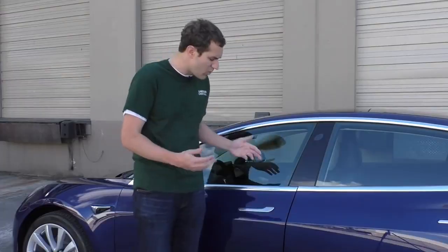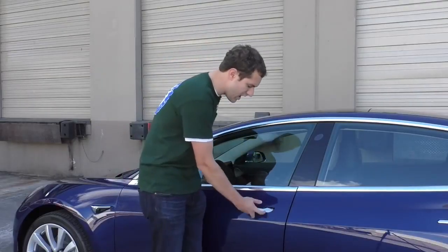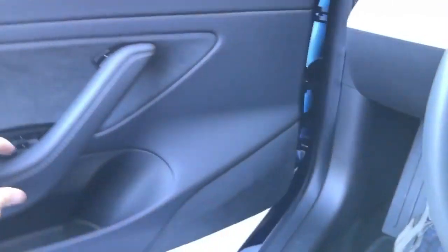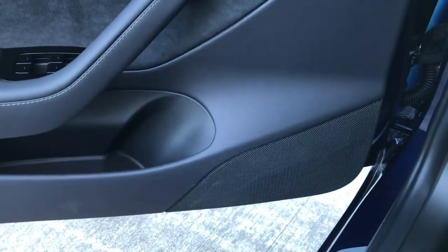I get inside to open the door. You push the back of the door handle, the front part comes out, and you open it right up — it's actually pretty simple. You push it, and the button unlatches the door, and it also swings it open a couple of inches. Then you have to do the work from there. Above the window switches, you pull it, and then you manually unlatch the door in case the battery dies and the electronic buttons don't work.